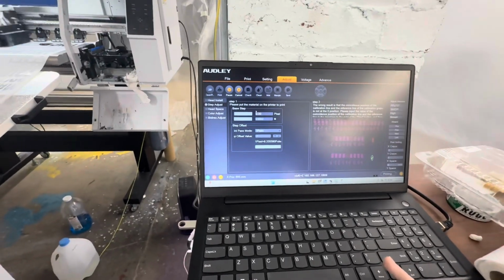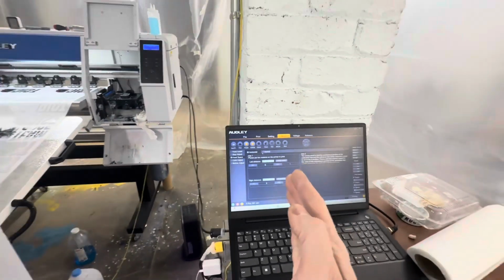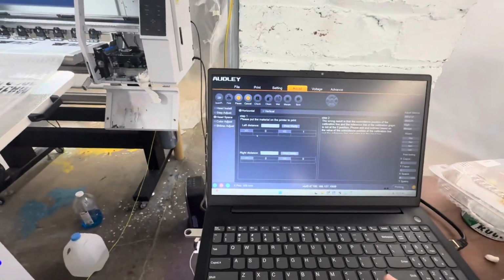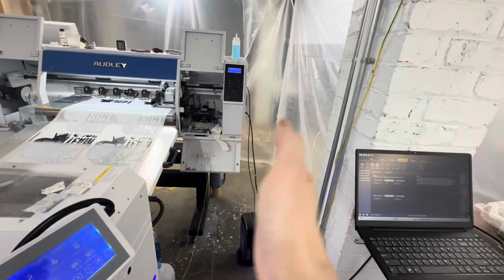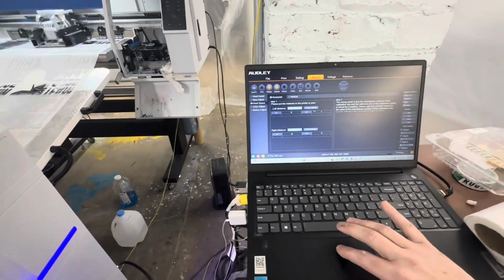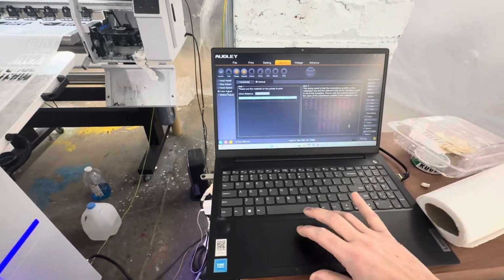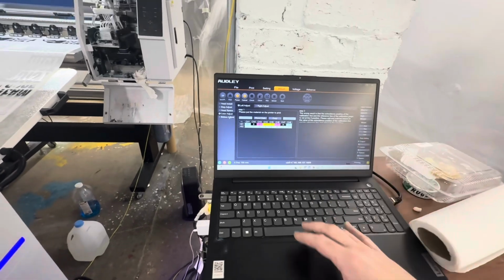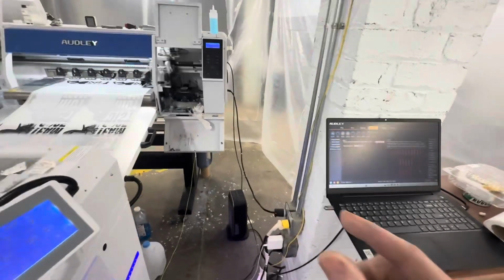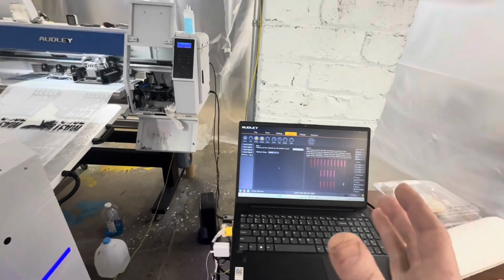These adjustments, like the step adjust and the headspace, are really where you're going to spend most of your time, digitally adjusting where the printer lands. For example, if your white ink is landing too far to the left and you have white lines on the left side of your prints, you would bring these in by reducing these numbers. Same with the vertical check I just showed you. The color adjusts, I've never played around with that, but you can do some adjustments in colors.